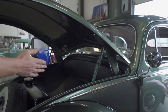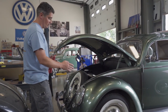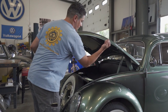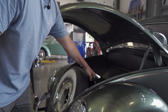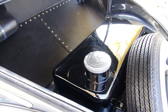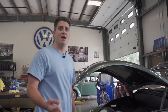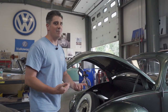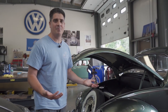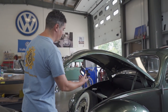No springs like later in the 60s where the hood got lifted up automatically. You have this prop and you've got to pull it this way to lock it in place, kind of like an elbow. This is where you fill up - here's a humpback gas tank. Before this you would have had a square gas tank. I had a client with a 54 Beetle and when he got the car in California, his one question was: what's this big square thing in the trunk? That's what I mean - as early as these cars are, some people today need to be reminded of how simple they are.